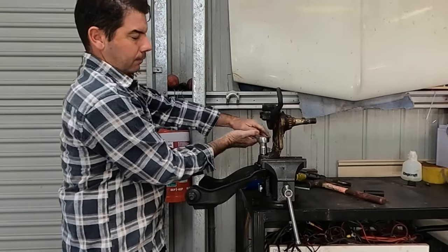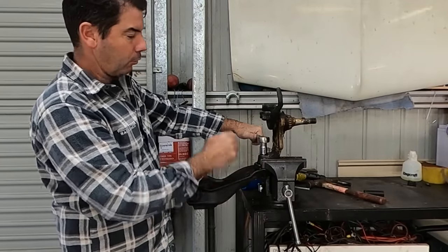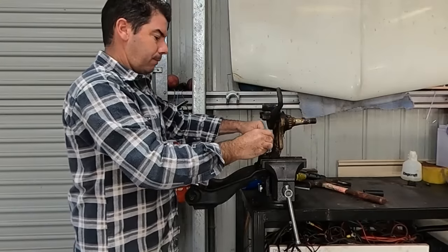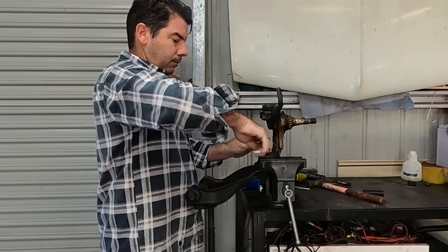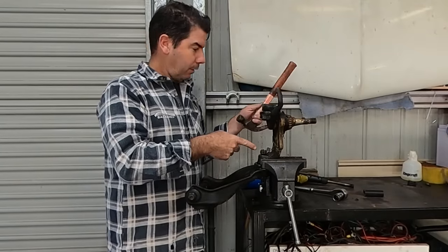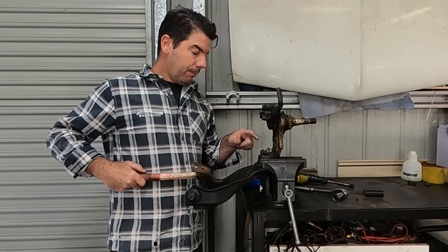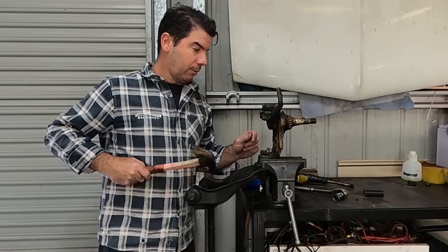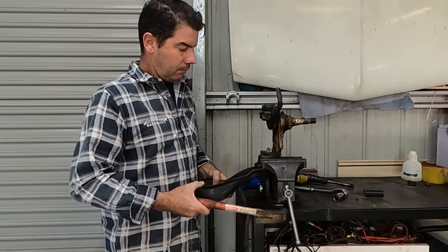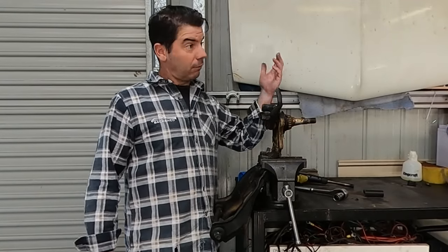Cracking, and I've just got the vise holding the stub and not the ball joint, not the control arm. Cracking, put the top of the, now we're not reusing this ball joint, so it doesn't matter if you destroy it. That's the wrong hammer, that'll do, whatever. Have your nut same height as the top of the ball joint, and just hit him. That's it. I'll knock that guy out, control arm go on the back of the shed for next HQ we get, if we get one.